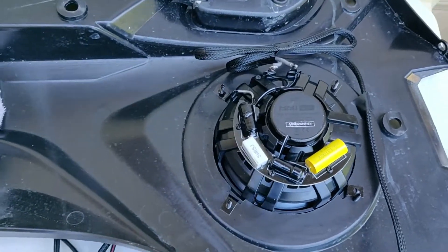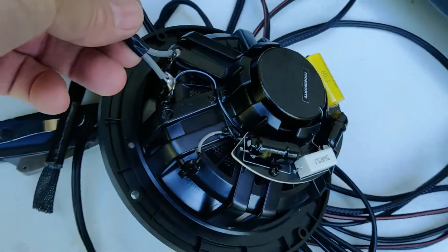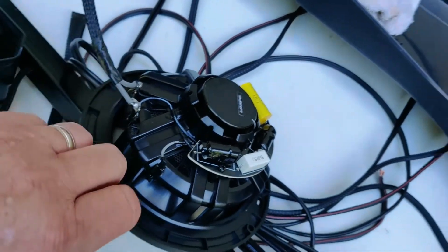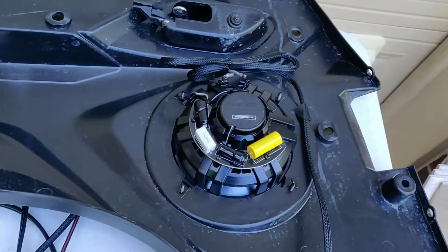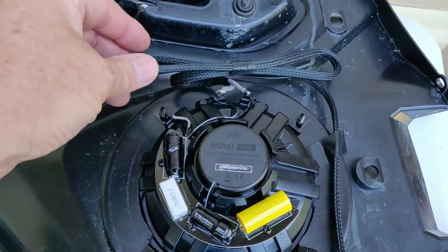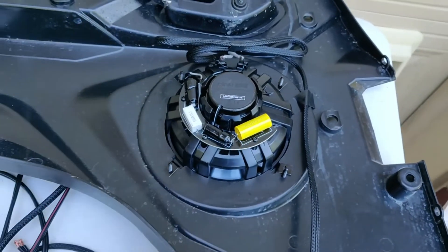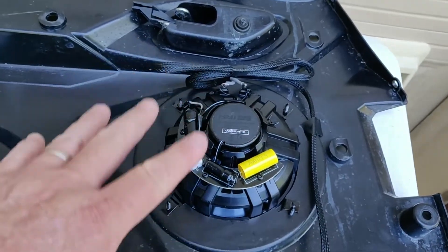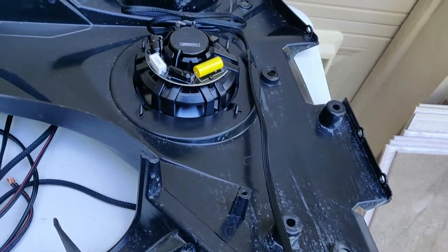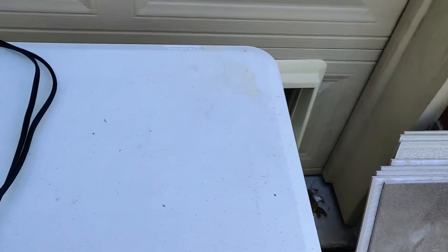Another thing I've done is got one speaker installed. I've soldered all of my terminals for my speakers. Some people may disagree because it's easier to maintain without soldering, but what I do is wrap a little bit of extra cord right there with my speakers when they're enclosed, so that when I need to maintain them I'm not fighting it — I'm able to pull it out, set it down, and work on anything.